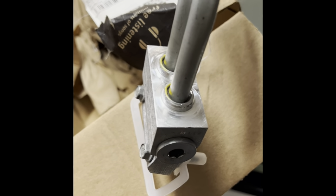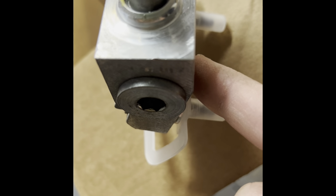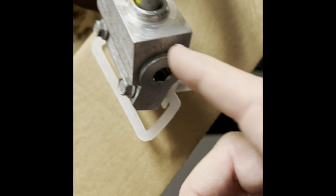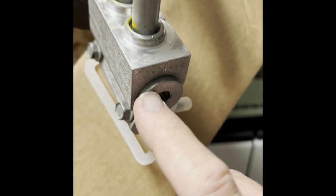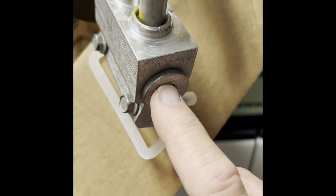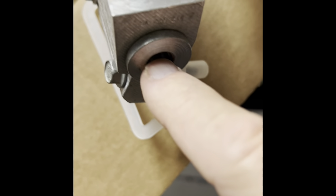Today I'm going to talk about, demonstrate, and show you how to fix this oil cooler line that seems to be everybody's nightmare. It started because I had low mileage and the gasket on this side was leaking, so I replaced that. About half a year later this bolt started leaking, so I'm going to show you how to make a tool, put it in the hole, replace the plastic seal with an actual o-ring, and put some Teflon tape on there to seal it up for good. My lines are good - once I discovered this allen head I knew I had a solution.